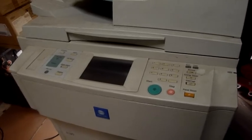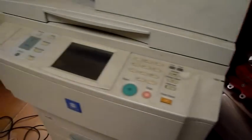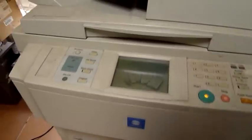This is what I'm going to be getting rid of. It's a high-mileage machine — it does work, but it's just dusting the pages with toner before they get to the fuser, and you end up with just black smudges all over them. The fuser is pretty sad, the photoconductive drum is pretty sad — it just needs a lot of money spent on it and I can't really justify it. I've got a good monochrome analogue to deal with anyway. It's a shame because it does work, but it doesn't matter.